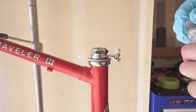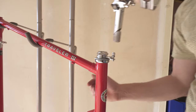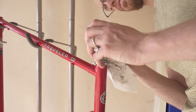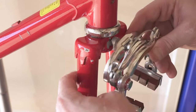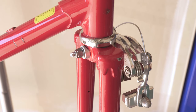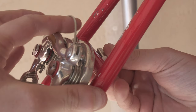A little bit of anti-seize is great to prevent future corrosion — remember, lube the hole, not the pole. Push that down in there, drop the stem in, and now you've got anti-seize in place. A lot of people use grease there, but in my opinion anti-seize is the better option. Grease does provide some corrosion protection, but over a long enough period it will dry up, whereas anti-seize does a much better job. In the event I don't disassemble this bike for 10 or 15 years and it gets wet, that quill stem should still remove.